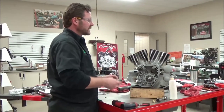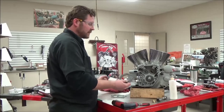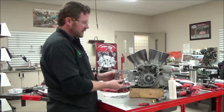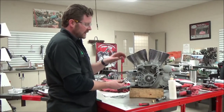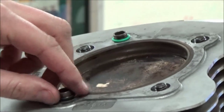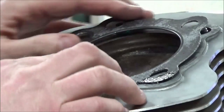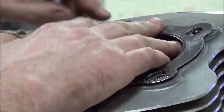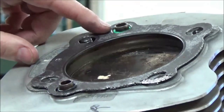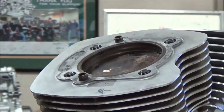I'm going to revisit head gaskets from an evolution video we did a couple years ago — I think this is really important. Harley-Davidson as well as other manufacturers have experimented with different gasket materials, makeups, and how they secure them with dowel pins. Common for Harley-Davidson is to have an o-ring around those dowel pins. This is the right gasket for an EVO — look at the dowel pin arrangement. It needed that o-ring and the gasket to do the job it was designed to do.